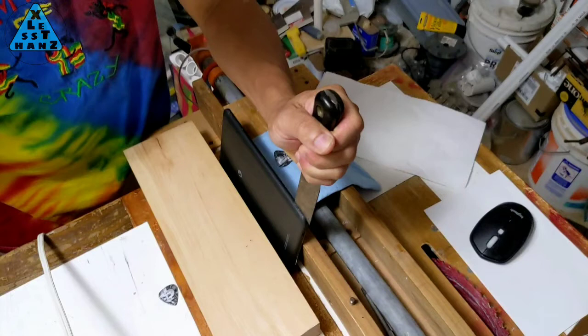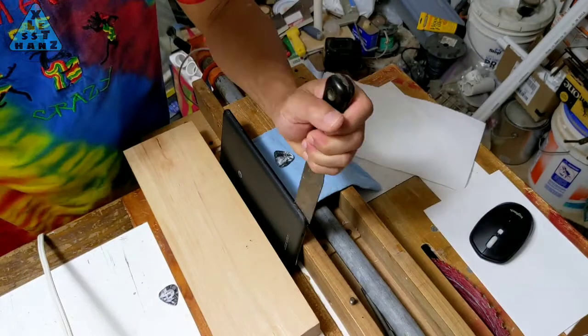At this point, I have to bring up the fact that as I'm doing this video, I'm also doing my previous video, which included using the iron to melt the glue holding the tablet together. What I didn't know at the time was the ZTE Trek 2 tablet is not glued together. So this video continues as usual, but without the need for any heating element. To be clear, there is no glue holding the tablet together, so a quick tap of the paint scraper, then some picks should separate the two halves.